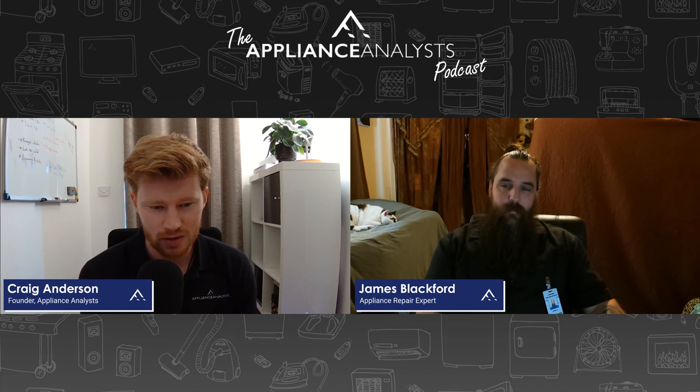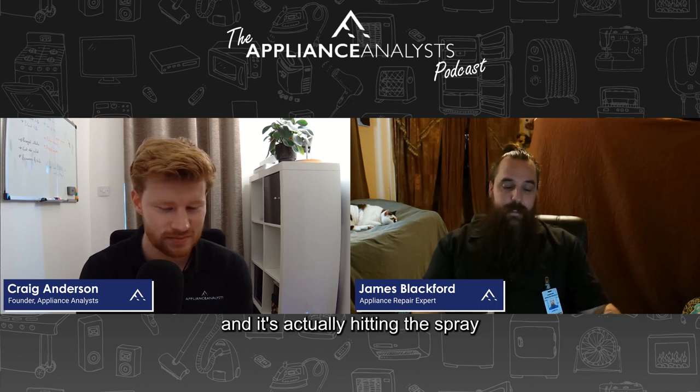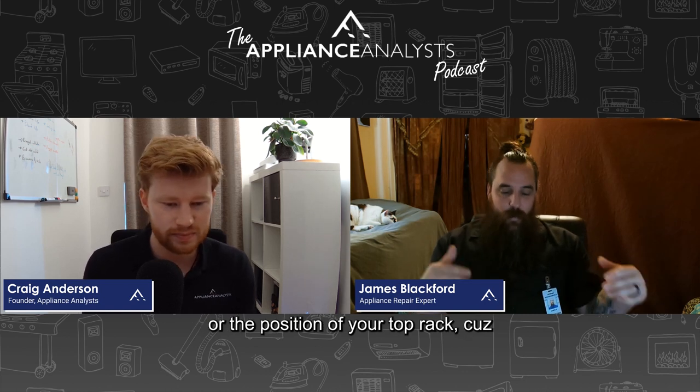Continuing with dishwasher sounds, any experience with a louder banging sound? Usually a banging sound is if the dishes aren't loaded properly and you have something that's getting knocked around, or if you have a really tall pan in the lower rack and it's actually hitting the spray arm from the upper rack turning. Fortunately most of the time that's just adjusting your dishes or the position of your top rack, because those typically do have two positions. So you can change it and hopefully give it enough clearance. Yeah, for sure. Nice one.